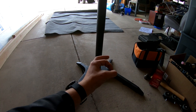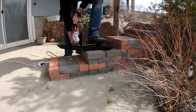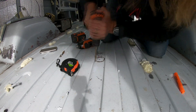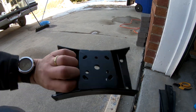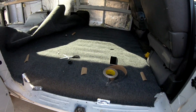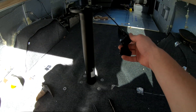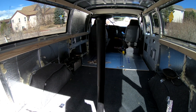There'll just be a little hole in the van floor and the shaft will go down and sit inside there. Here I'm cutting out the hole for the shaft so the table can go through. The base of the table looks like this configuration, and I got some pieces of rubber to use as gaskets so I can have a nice tight fit without any vibration issues. Here's the first layer of insulation going in. This is the bed configuration, and when I want the table configuration I raise it up — this thing is strong, it's kind of scary how strong the hydraulic is.